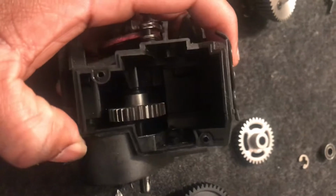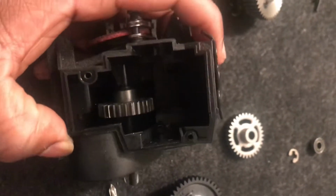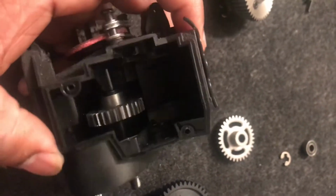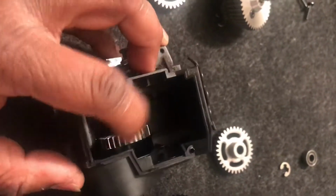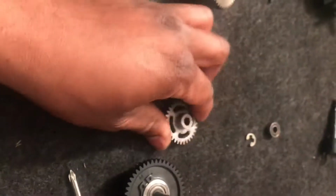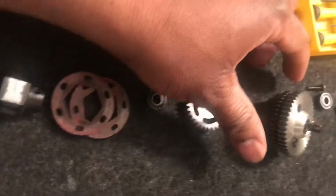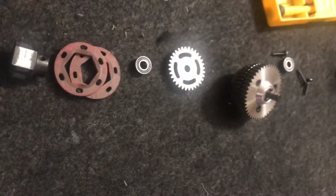You'd have enough play. And if you get a little bit of rub off the gear on the plastic housing, that's normal. It's plastic. Tolerances are all over the place. The good thing is it's nylon, so it will just get smoothed out by the gear. So again, you would need to take this from your 2-speed, machine this down to make it nice and smooth, put it right beside the Mark Desmond gear here, and that's how you get your Bulletproof mod.